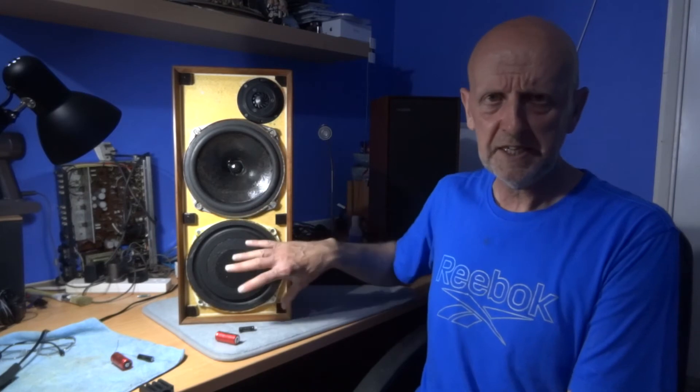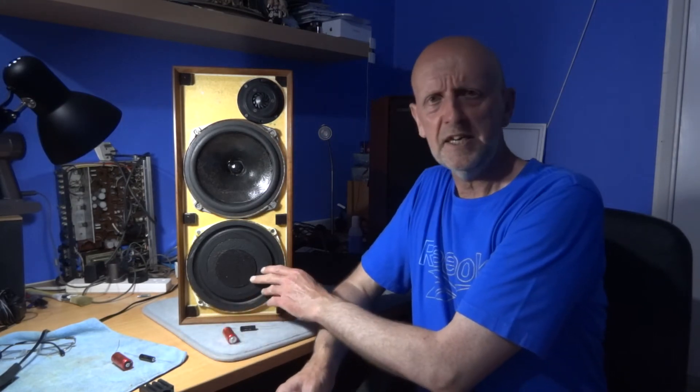The passive front speaker has no wires connected to it at all, so it's fairly safe — you won't mess anything up doing that. Obviously if you have a speaker with wires, just be careful taking it out so you don't pull the wires too much. It's not the end of the world because you can always re-solder the wires, but it saves a little bit of hassle. Just take it out gently and lay it next to the speaker on a flat surface, making sure nothing there could damage the cone.